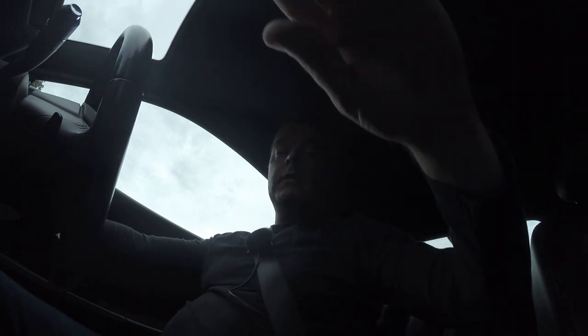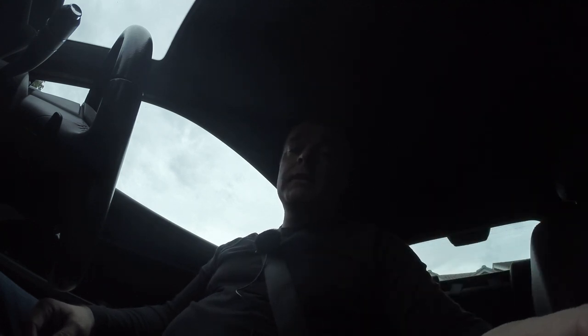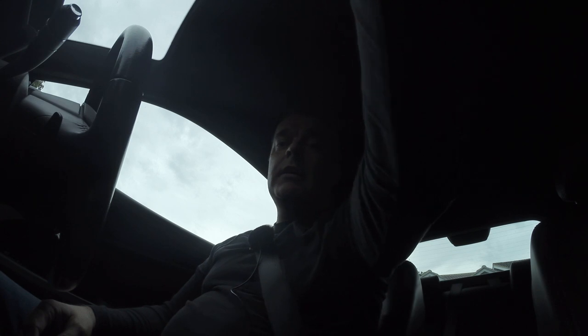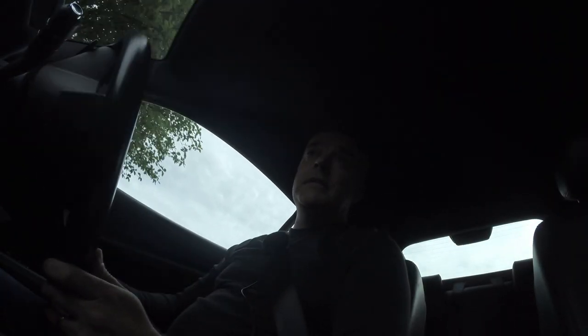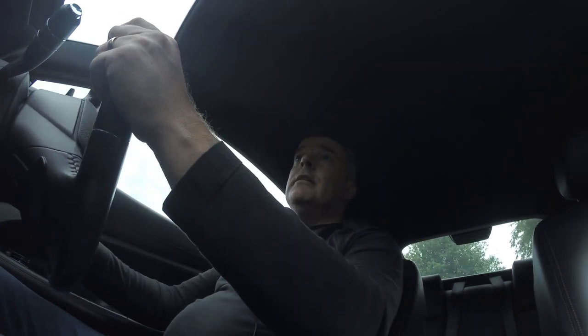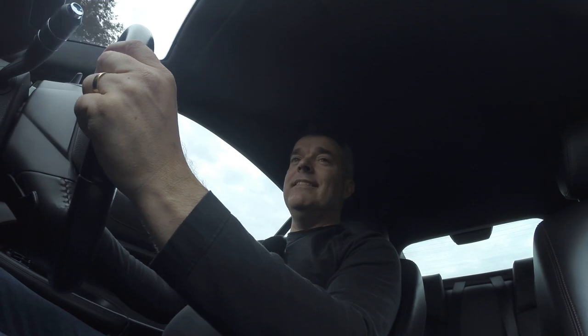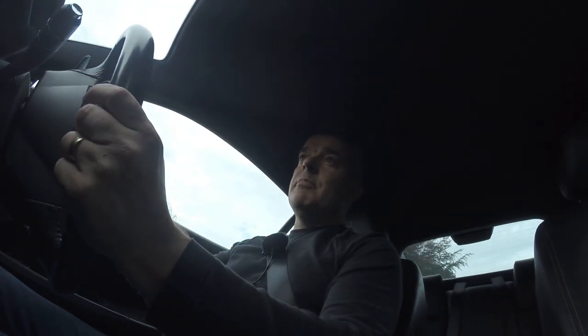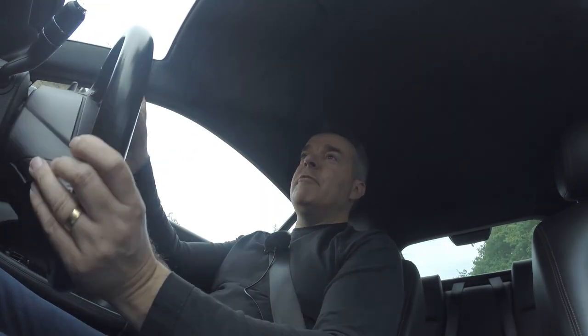So I'm going to go for a test drive. I've definitely got cooler air from the driver's side zone now. So I think in time it might work its way through and I'll have to re-top up later. Can't hear any hissing, doesn't seem to be losing lots of pressure. It's ice cold on the passenger side, so let's go for a little drive and see what happens. I'm leaving the AC on, full power, full fan, full cooling, just to see what goes. Definitely better. I'm hoping I've got the right pipe and the leak isn't going to prevail and I'll lose all my refrigerant again — that would be disappointing. But it seems to be holding good.